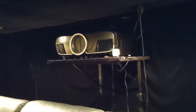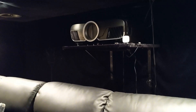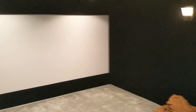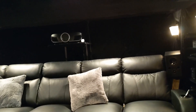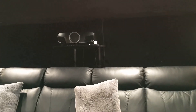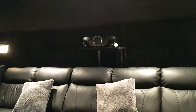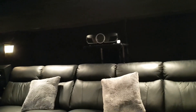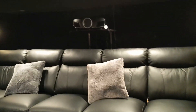Very simple — I wish I thought of that before, honestly. The biggest pro from doing this, besides giving a home to this projector, is that the lens on the 6050 is now at least a foot closer, maybe a foot and change, closer to the screen. That reduces the throw distance from about 19 feet and change to just about 18 feet. I know that doesn't sound like a lot, but with the Epson 2150 I was running that in dynamic — torch mode — with positive gamma at around 50-50 brightness. With the 6050, I can run it in bright cinema with no gamma correction, so zero gamma, at about 45 brightness. It is much brighter, and I think that's because the lumen output is a little bit more with this projector and the fact that it's closer to the screen. Same screen material, same room — so that's a noticeable upgrade.